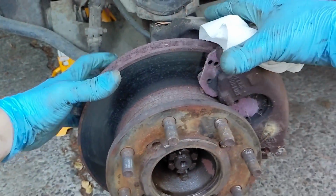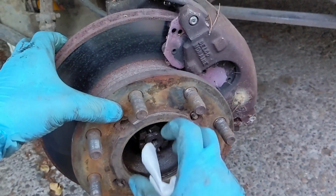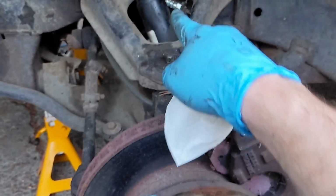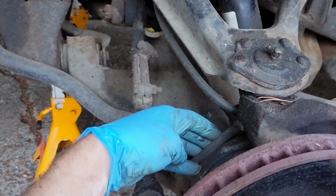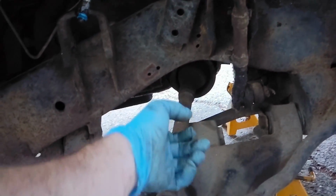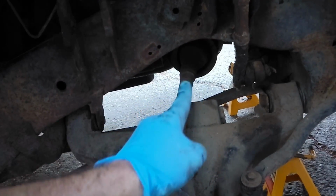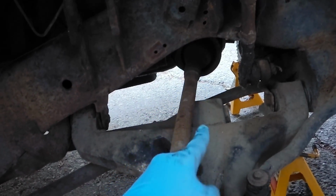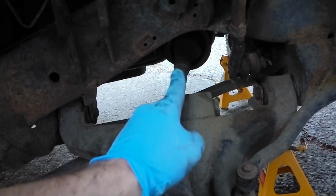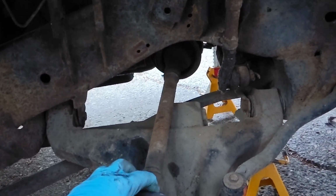As the whole knuckle here kind of flops down on you, you can punch the axle out of the splines. So this basically just slides back and you end up with your axle just sort of dangling. See, just like this. Now I could pull it out from up there as well, but if I did that, I would start to leak transmission fluid. I think it's transmission fluid, so I don't want to do that until I've got a bucket under there. But I will be replacing these drive shafts. I had new ones that go with the new front end.